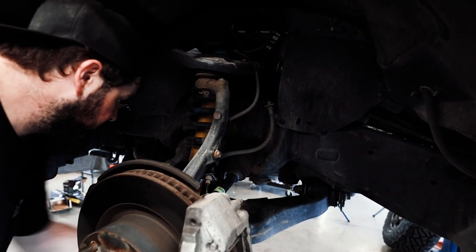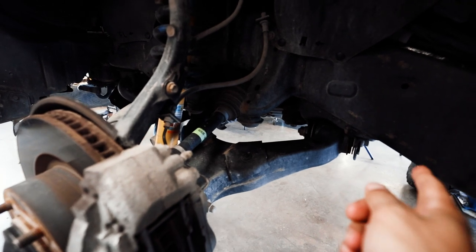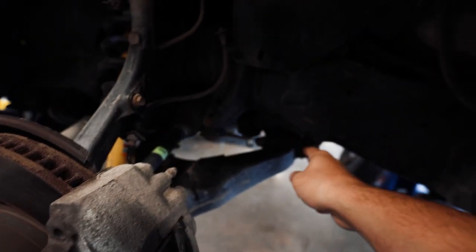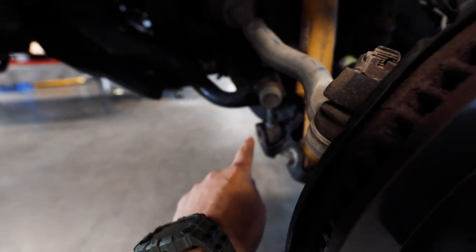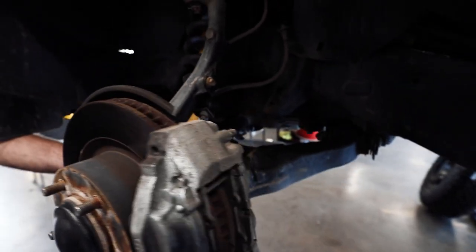To start on the suspension overhaul, we're going to loosen the 24 millimeter lower cam bolts just to be able to get this arm out of the way. Once those are loosened, we're going to remove the knuckle bolts. Then we remove the 22 millimeter bolt on the sway bar, the 24 millimeter lower shock bolt, the lower knuckle bolts to get this to drop down, and then unbolt the 14 millimeter nuts up top to lower the shock out.